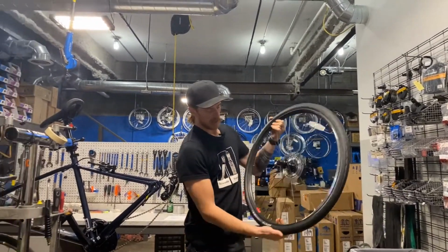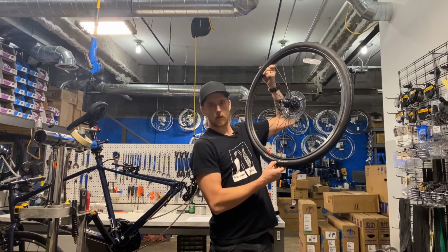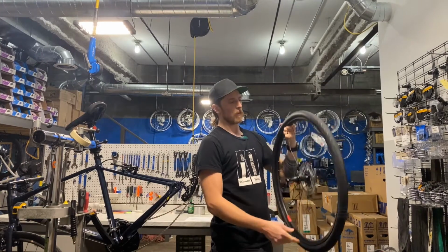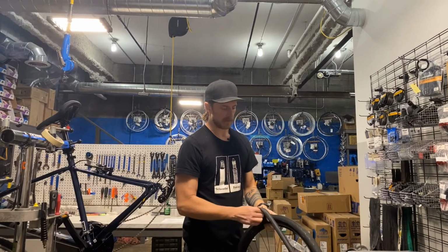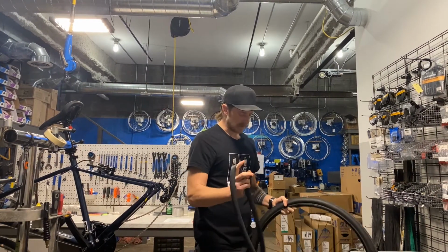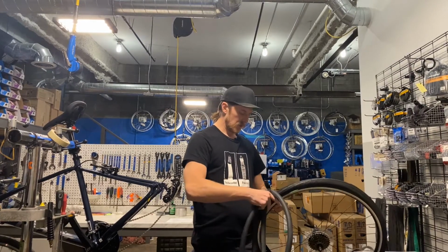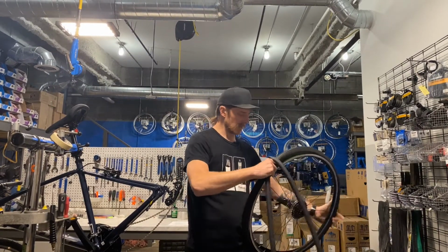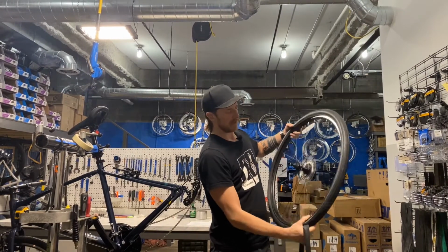Then, next, if you can see here, the valve is in line with the label on the tire. This is also how we want to put it back together, and we also want to remember that orientation because it makes it easier to find the cause of the flat. So I'm going to pull the tube out, but I'm not just going to whip it all around and twist things back and forth, so I can keep the orientation straightforward in my mind. So I drop it back down the way I got it. That last part, I'd kind of pinch the tire over and pull the valve out.